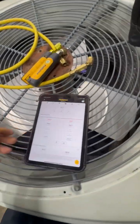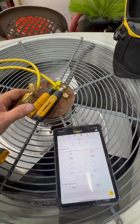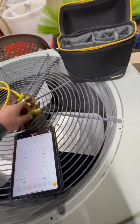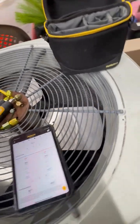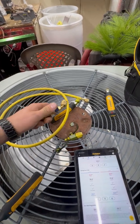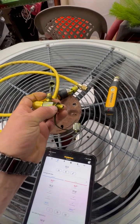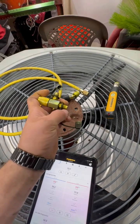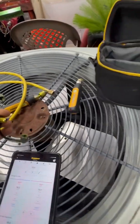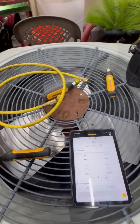This is something I highly enjoy working with as far as hooking these up to put refrigerant into the unit. What I do is hook up one end to this and then hook up the other one to the refrigerant, and then you just open and close it whenever you want to add refrigerant. Also, if you wanted to add leak seal or UV dye or something while you're checking it, you'd have one of the probes on this and whatever you wanted to put into the system.